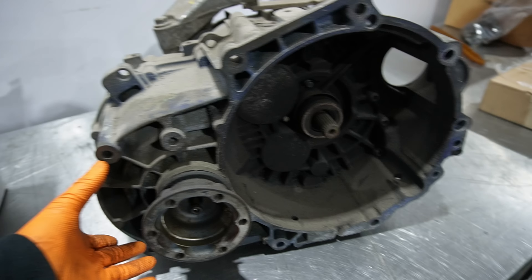You can now see the difference between a front-wheel drive differential and an all-wheel drive differential. If you're doing an all-wheel drive swap using an existing front-wheel drive transmission, this is the key piece needed to connect and actually spin the angle drive. The case itself requires the four bolt holes as discussed, but this is the main piece that makes it all function properly. We also have new shifter forks going in and the case modified.